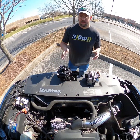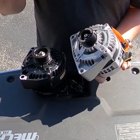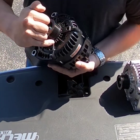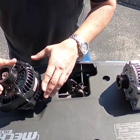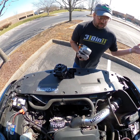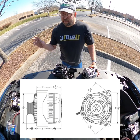Even though these are just ten or so amps apart, you can physically see one is bigger. The easiest way to spot the difference: if it's got three little ribs, that's your small case. If it's got four ribs anywhere on it, that's your large case. This small case is for GM truck, race car, and universal applications — it has the same bolt spacing, I think it's five and fifteen thirty-seconds inches, and that data is on the website.